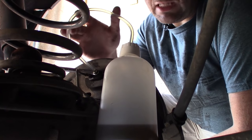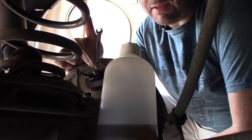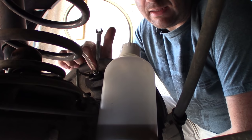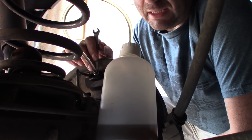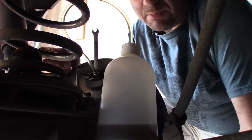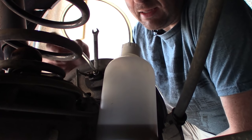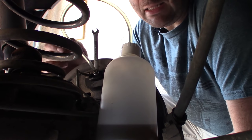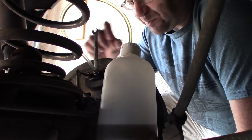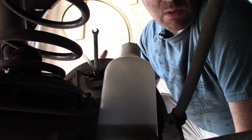If you're having any trouble keeping the fluid in this bottle, especially after you close the bleed nipple off, if this starts to disappear and the fluid goes back in, that means you've got a slow leak in through your bleed nipple. What you want to do at that point is take the tube off, remove the bleed nipple, put a little catch pan underneath the brake in order to catch the dripping fluid. Take the bleed nipple out and clean it up. You're almost certainly going to find corrosion on it, and you want to clean it with a wire wheel on a drill,